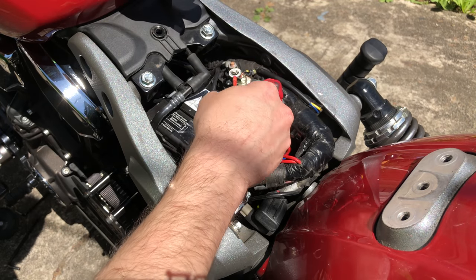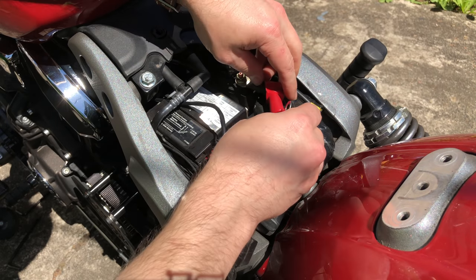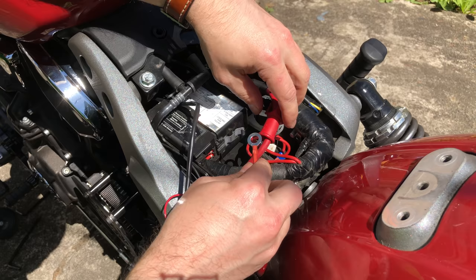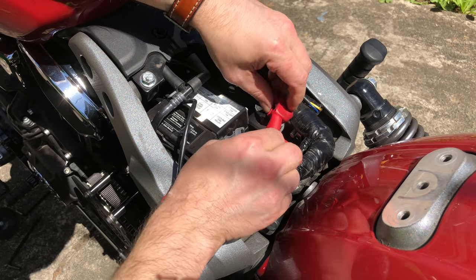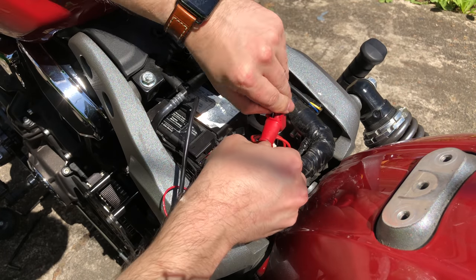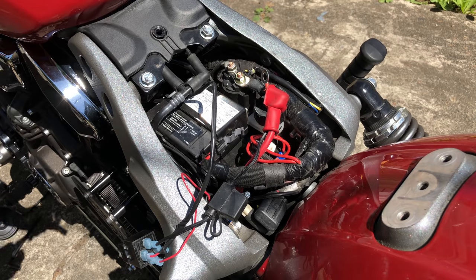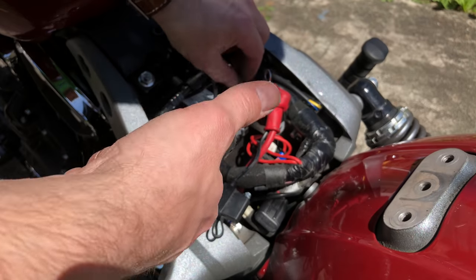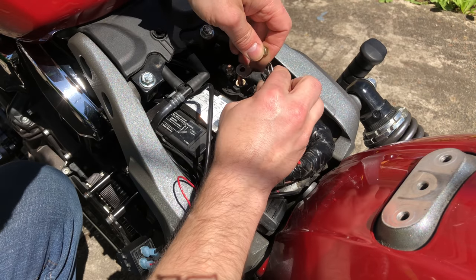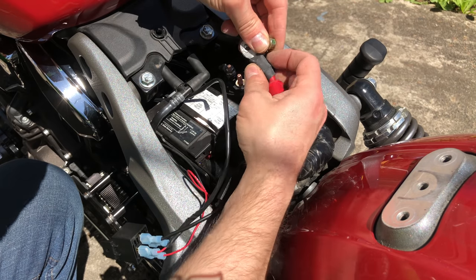This goes to the final lead on the relay. I could go down to the battery, but I've already got so many things hooked to the battery — I'll just catch it up here instead. I'll fish it through here on the underside, and I can still put the protective terminal cover over it. This is in from the battery, the other side's out to the starter. There's a starter solenoid that I'm tapping off of — it's a good source of constant power.